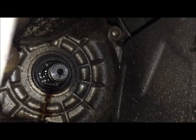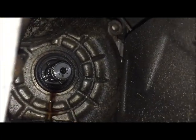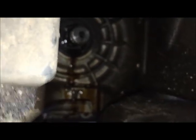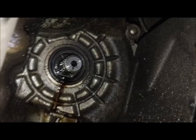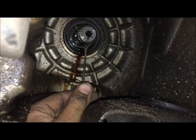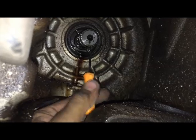What you're looking at here now is the axle where the CV joint goes right into the side of the transmission — that's where all the fluid was pouring out that we had to clean up. I thought it would be okay because I actually put the vehicle on an angle and this side was higher — that's a joke, by the way. This is on the bottom of the transmission, so all I'm going to do now is take a pry tool in there and pop that seal out.